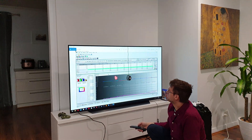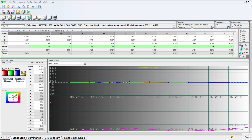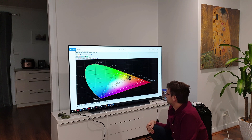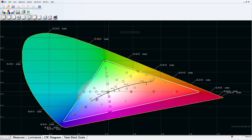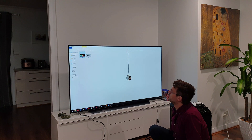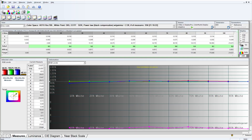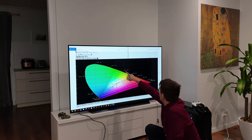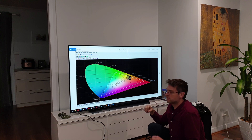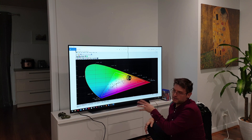I'm very impressed with the result. For normal gaming mode, the color space is very accurate. I haven't touched the color management at all, so this is very good out of the box. Looking at the Gaming HDR grayscale, also very good — all delta E values are below 1, with the highest at 0.8, which is very, very good. The only thing I need to address in HDR is the color space is a little bit too wide and extended, but I'll cover that in my next video when I do a detailed calibration video for this TV.